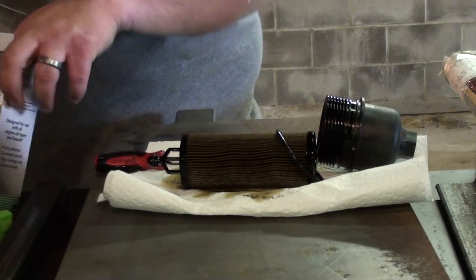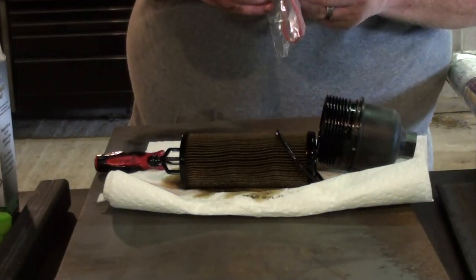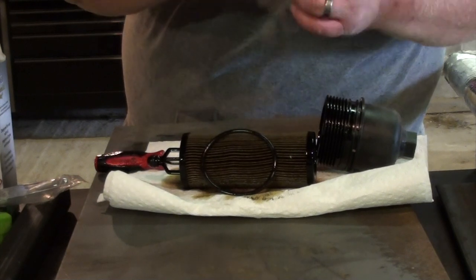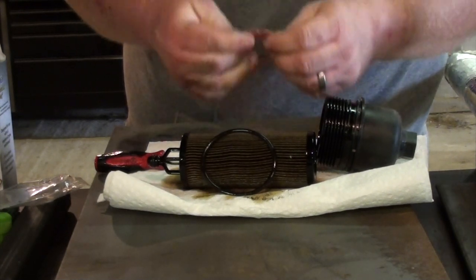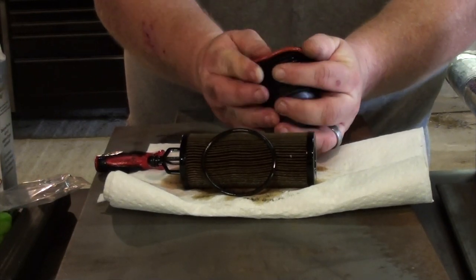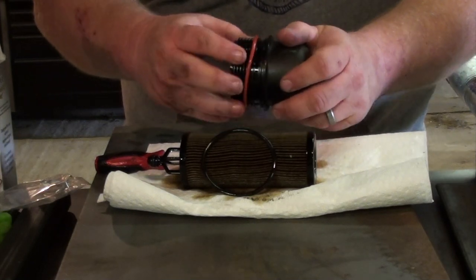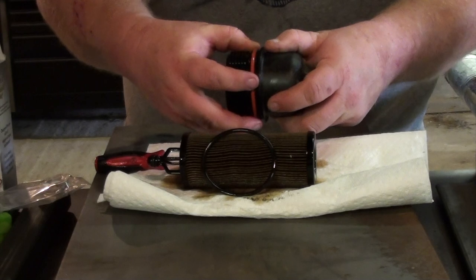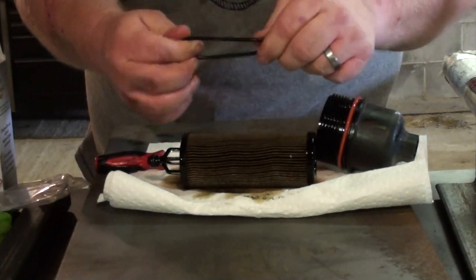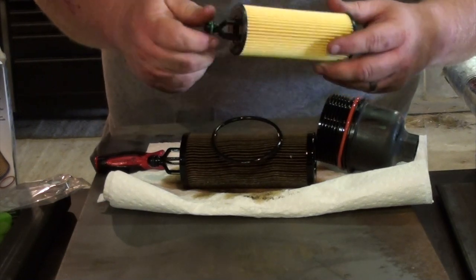Get the new O-ring that was provided with the cartridge filter and install it on the cap. Get a little bit of the used oil and rub it on the O-ring — this will lubricate it and make it a little bit easier to install. Once you put some oil on it, slide it over the threads and seat it back down in the groove. Be very careful not to damage the O-ring. Once you have it seated, go ahead and install the new cartridge — simply push it down into the cap and you will hear it snap in. On the other end of the cartridge where the tab is exposed, lube up the O-ring on that side as well.